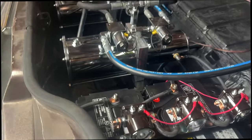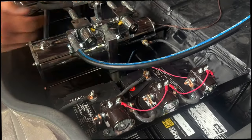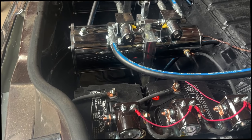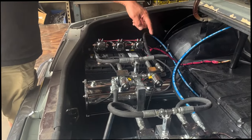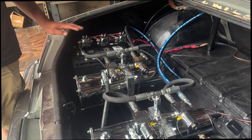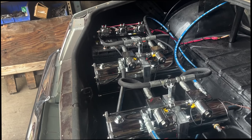The number one thing that goes wrong with hydraulics is you can lock up a line of solenoids. I might have explained to you, when you hit that switch, it turns these switches closed so that power goes to the motor. And they're all 12 volt. That's why they can stick. It'd be like starting your vehicle with four batteries when it's all designed for one. Do you know what I mean?